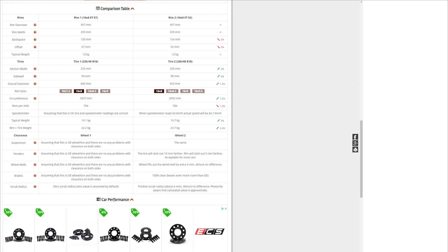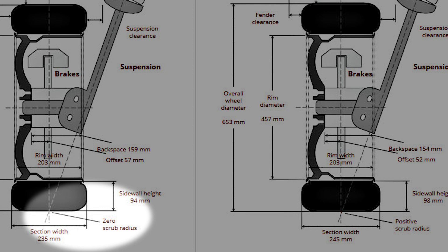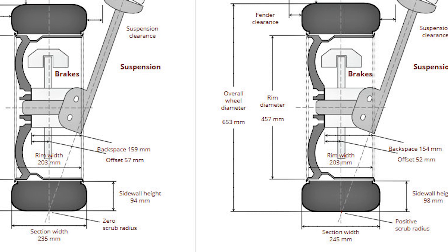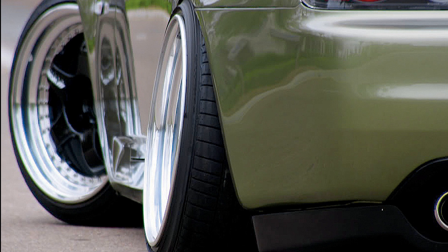While we're here, I'd like to address something called scrub radius. As you push the wheels out — either with spacers or a lower offset wheel — the center line of the wheel at its contact patch becomes increasingly distant from the diagonal line of the strut. If you just want your car to look cool, running the wheels flush to the outside is more aesthetically pleasing, and for tooling around town scrub radius means very little. However, if you're trying to fine-tune the suspension for the track, it does take on importance — under heavy braking, acceleration, and cornering, scrub radius will affect toe-in and toe-out.